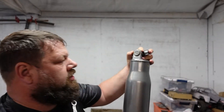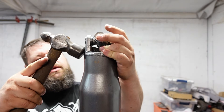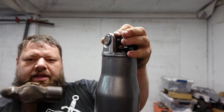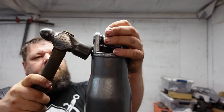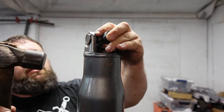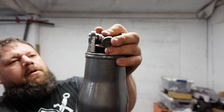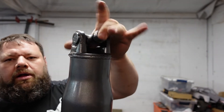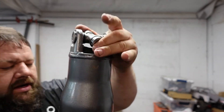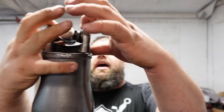It's a little bit over-pressed. What I'll generally do is I'll tap both sides and it'll kind of pull the bearing back out. So right below the bearing, right there — you want to free it right up, just enough to kind of get the bearing cap seated to the outside here.